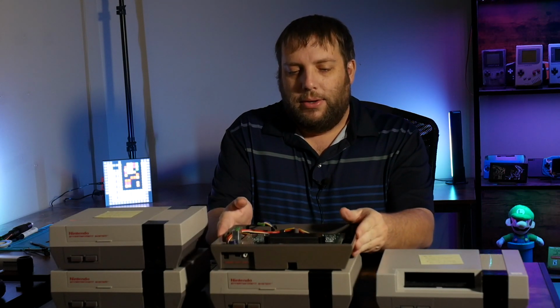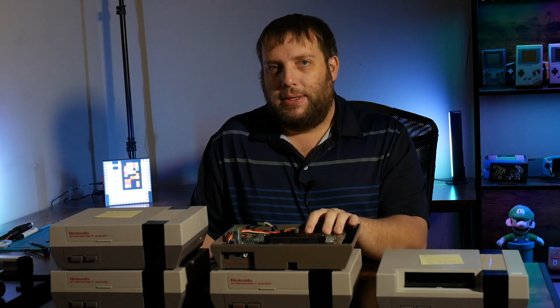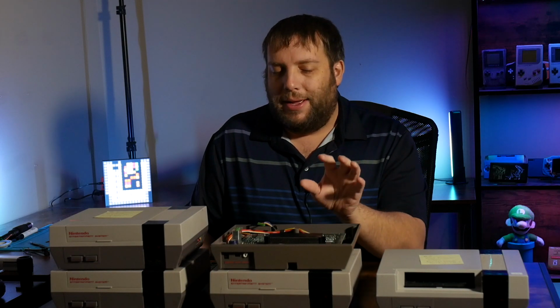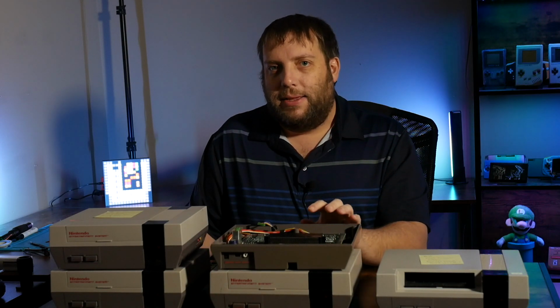Now the other system that I talked about at the beginning of the video is this one here. I worked on this one quite a bit before even starting this video, and I'm pretty sure I've narrowed down the problem on this board to also an SRAM chip. On this system I've tracked it down to being an issue with the WRAM chip. Just based on the symptoms I'm seeing, plugging it in and just getting a gray screen regardless of messing with the connectors or doing any of that kind of stuff, I'm pretty sure at this point it's likely the WRAM chip.